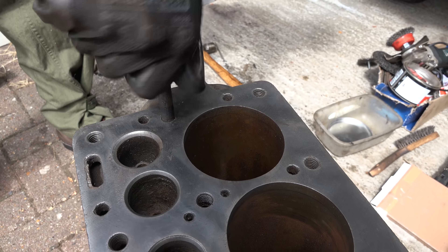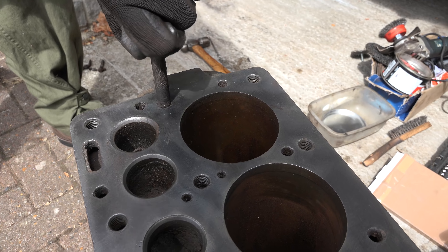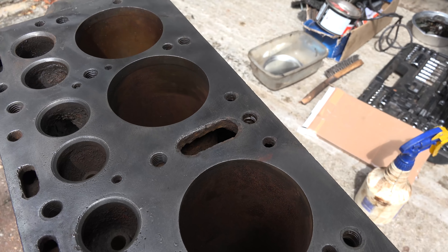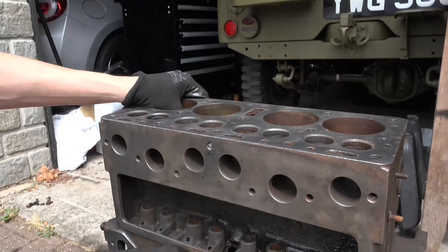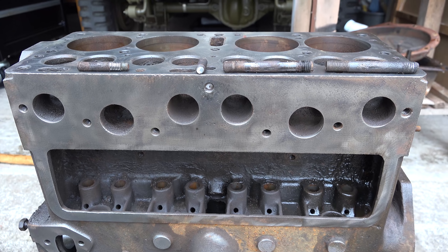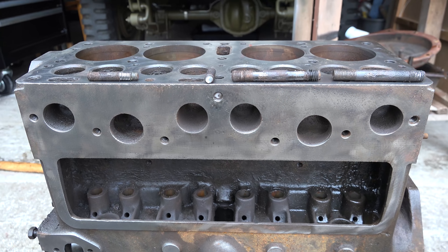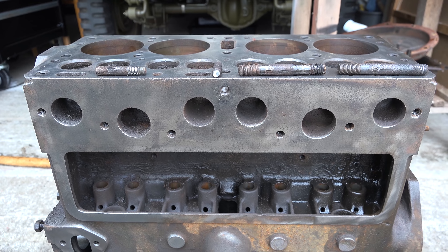We're trying to do this properly so I don't think it's viable to leave it - that'll have to be redone. I think there's two like that - that one and then one of these guys as well is done, so unfortunately that's got to be redone too. And then on the side, unfortunately one stud broke off there - you can see it's sheared, which is disappointing but that's unfortunately the way it goes. The rest of them were okay - it was just one which sheared and the threads look all right, so that's pretty good.